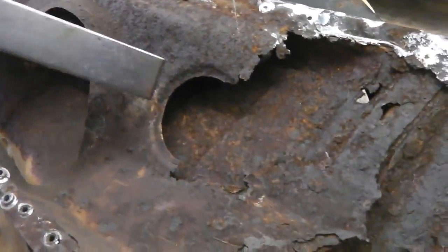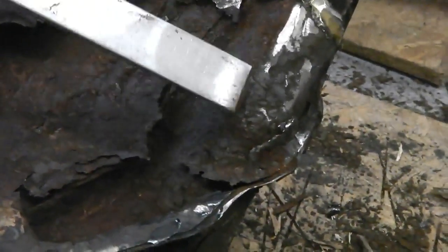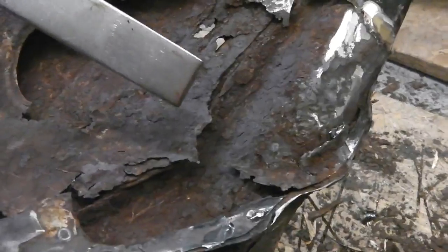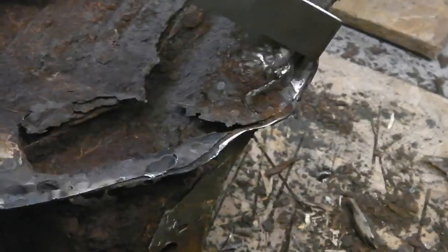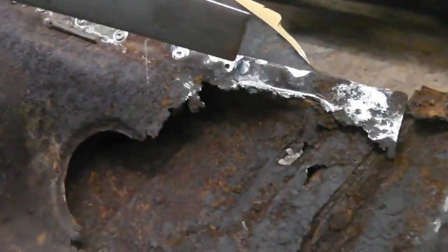And you can see that this metal continues across, and then it actually lands on the A-pillar base, which is why if you're ever cleaning up your A-pillars when you're doing your scuttles, you see all flaky metal on it and you think that your A-pillar's rotted. It hasn't. It's the remnants of that bulkhead top panel. So that continues along. It even follows that little shape round there. So we've got to make that. It wraps around that, forms part of the top flange for the windscreen seal.